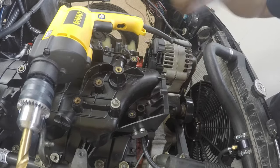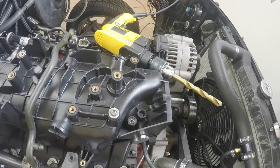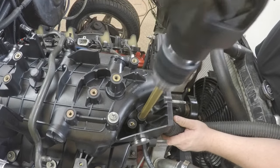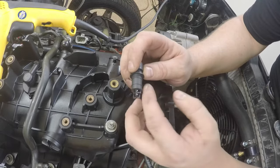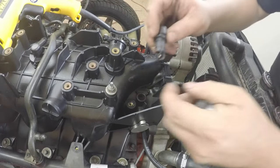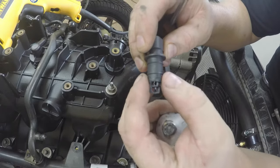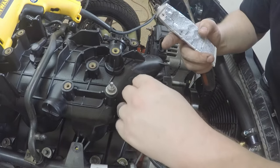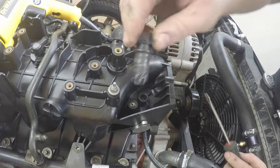That's not going to do it - I need a little bit more. I'm going to do the same thing now with a half-inch drill bit, which is the biggest I can fit. Still not quite enough. I'm going to run this edge real quick over my bench grinder just a little bit. I ground that last little ridge off and it actually fits pretty good in there. I'm going to RTV it and tap it in with the dead blow hammer.